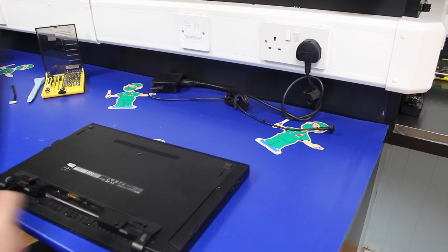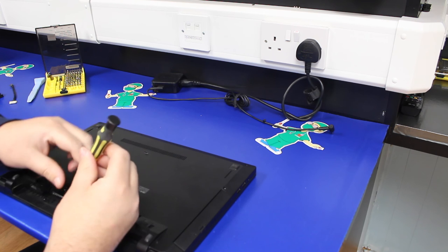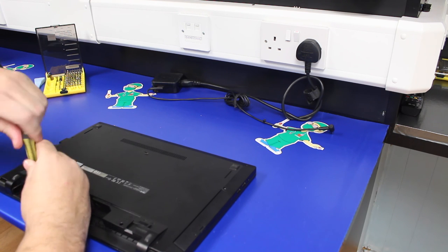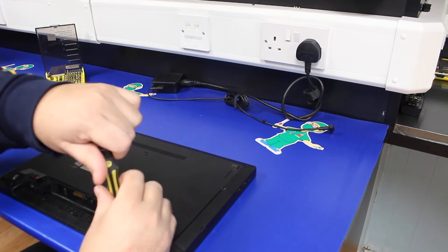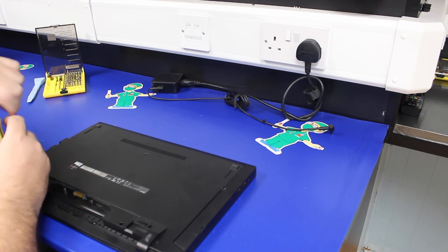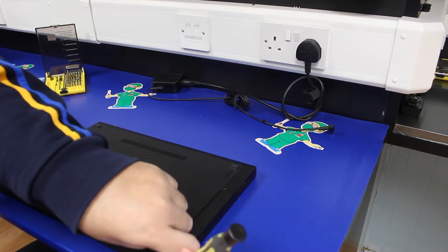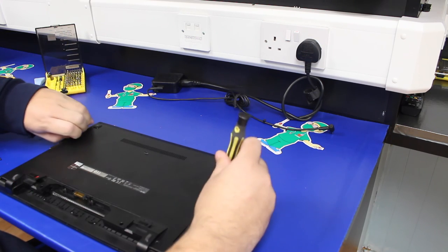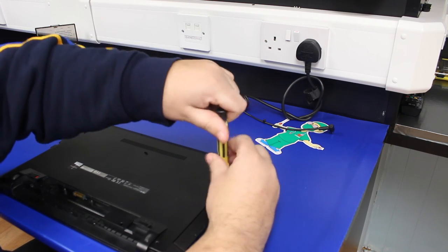To replace this one, turn it over. The first thing you do is take the battery out. There are a number of screws that need to come out: first, four in the back under where the battery sits — one, two, three, and there's one in there but it's actually missing on this machine. Then two hinge screws — these are quite long — one and two. Then two at the sides. Those four are all the same length; the longer screws come out.